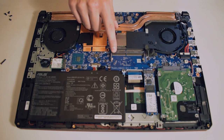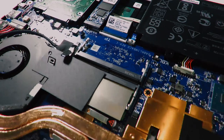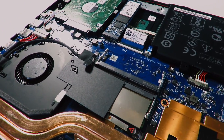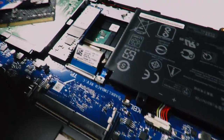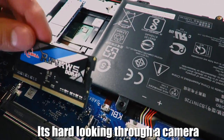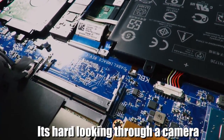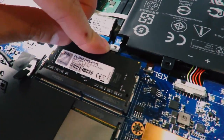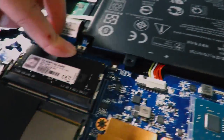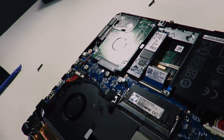Right here is the RAM slot — let me get a closer shot of that. There is the SODIMM slot right there. This one is already put in, and I have the other one right here. If I line up the pins, I should be able to put it down in — just like that, and it clicks in. There we go, upgraded the RAM. That was about the easiest part.